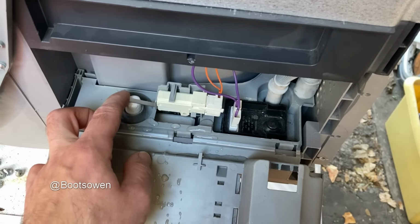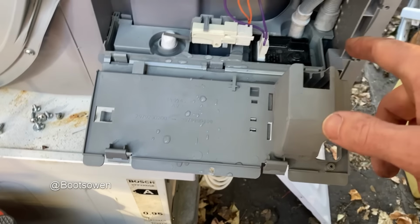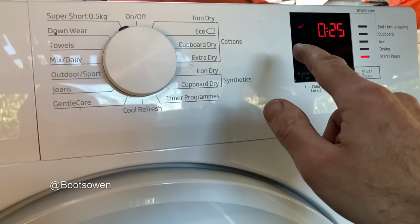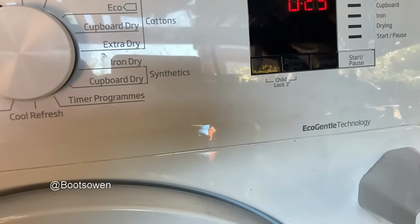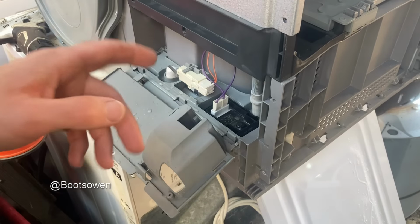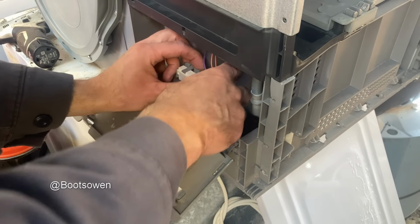The switch is high now, so it should be pumping. So there could be a fault on that. I'll take this out and take a look at it, make a mess, I guess. Just as that happened, this light came on, which I think means it's not pumping enough water. 25 minutes to go, let's turn it off, plug it out, and take that pump out and have a look inside it and see if it is those wings. I suspect the float switch was telling it that there was too much water in it.